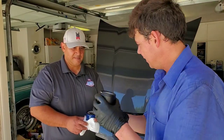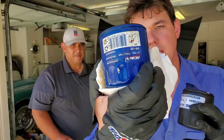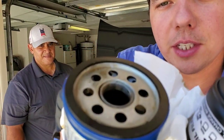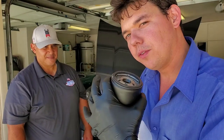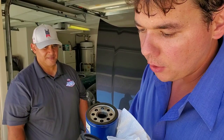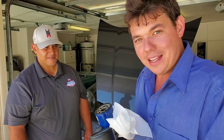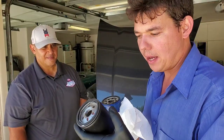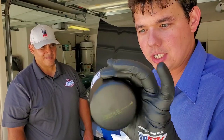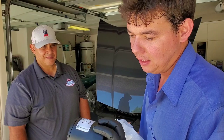It shows all your specs. I want to show you the AC Delco filter versus the AMSOIL. So this is your standard AC Delco — I want to show you the difference of the anti-drain back valve. This anti-drain back valve holds up a lot better over the course of the year, so it doesn't deform, it doesn't let the oil flow back out. So on the next cold start, boom, the oil circulates right away. Also, the medium is synthetic in this — it holds four times more contaminants than cellulose paper filters, so it'll hold up a lot longer. The threads are a lot bigger — you'll see the thickness of the threads on the AMSOIL versus the thin threads on the AC Delco. These just hold up better and they hold up to a rock better too. The actual outside of this cartridge is thicker where the OEM isn't quite as thick, so it can penetrate pretty easy and actually leak. It is an upgrade — it is different, and it's actually something you can feel.